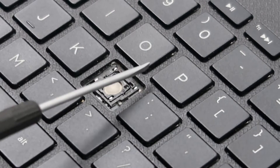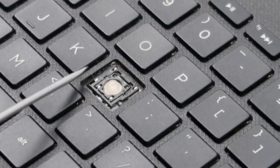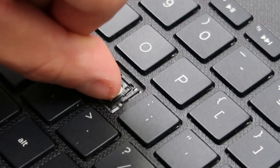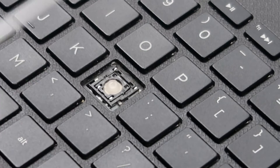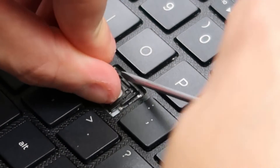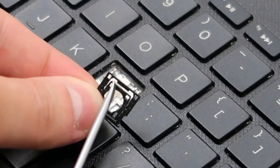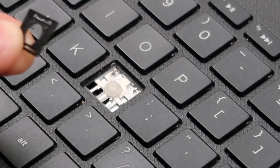To get this retainer clip up, I'm going to look for the plastic clips closest to the edge — in my case the top ones. See how they're closer to the edge than the bottom ones. Those are the ones I'm going after. There's not a lot of wiggle room; it's pretty tight, but I'm going to push up a little bit on the retainer clip while I gently try to wedge the plastic out from under these metal clips — this is where you're going to break it if you do break it, so be careful. Just push up, pop that out, and that one out. There's your retainer clip — as you can see I didn't break it. If I did, these wouldn't be complete circles; part would be broken off.